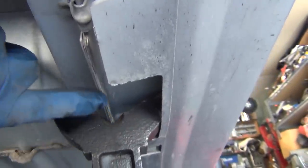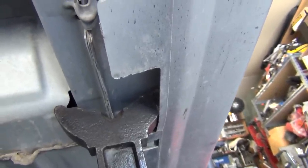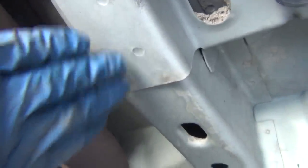It's good to have something that's slotted to interface with this pinch weld, because it's a lot better so it doesn't fold it over. If I'm using a flat jack like a floor jack like this one or like that one, I'll opt for something heavy duty like this or where it's multi-layered right here.